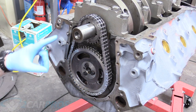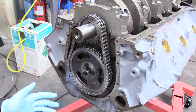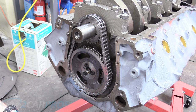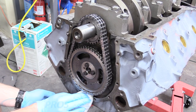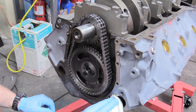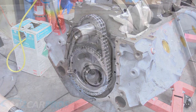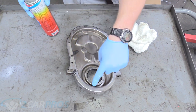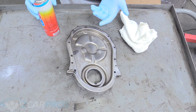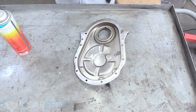The next thing we need to do is clean our gasket surface area for the timing cover. This seal is incredibly important — if it is not clean and not installed properly, it will leak oil for the life of the engine. We're going to get some carb spray, apply it to a paper towel, and clean this surface really well. If you think you're being too obsessive with how clean it is, you're wrong. You want it to be as clean as possible. Apply carb spray to a shop towel and make sure the whole mating surface where the seal's going to go is nice and clean.